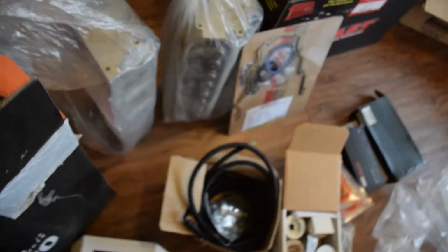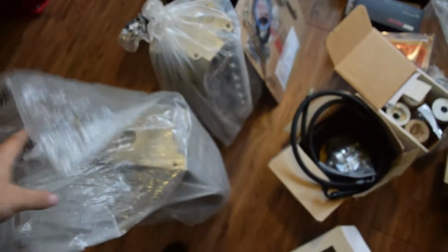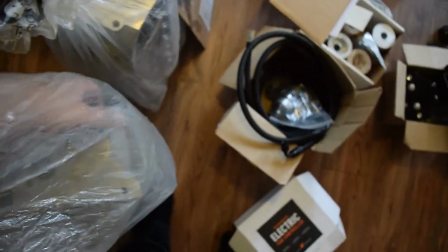What you need to do is actually go ahead and get their valve spring upgrade kit, and that came with the retainers and everything, the valve seals, and then the double valve springs, of course. And I actually have already dropped off my 799 high compression heads, which are the same casting as the 243 heads. If you guys don't know, that's like the LS6 Corvette heads.